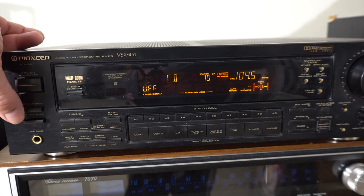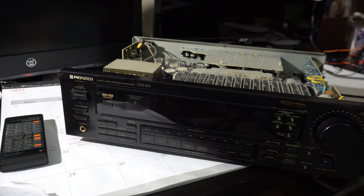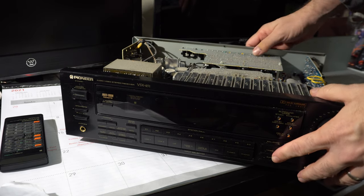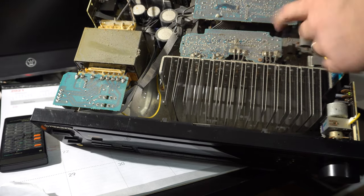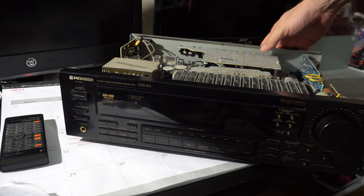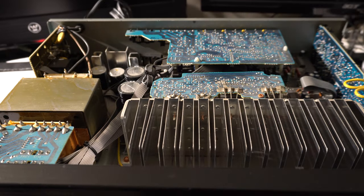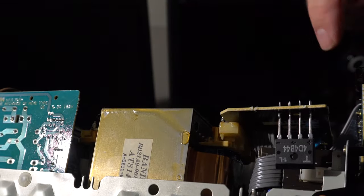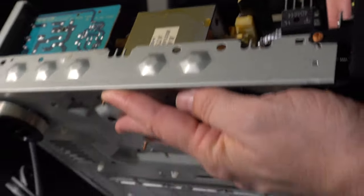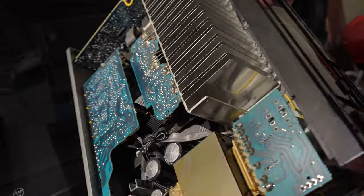After that I was pretty sure the problem had something to do with dirty switches. The first thing I noticed after removing the cover was the extreme amount of dust on the inside — after all, this thing is 30 years old. I cleaned it off with the air compressor to get the dust out. Then it was a question of how to get to those switches. Unfortunately, the switches are mounted on a board underneath another upside-down board attached to a transformer. I tried forcing some DeoxIT into a little hole on the side of those switches, then repeatedly pressed the switches over and over — probably 30 to 40 times. And that did the trick.